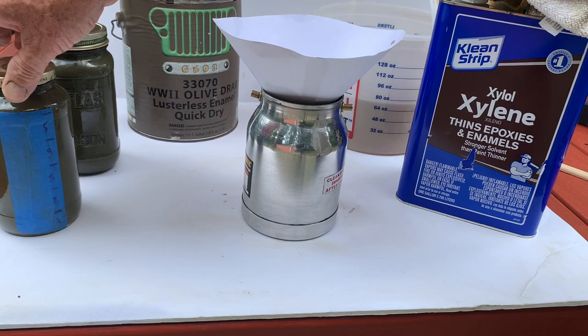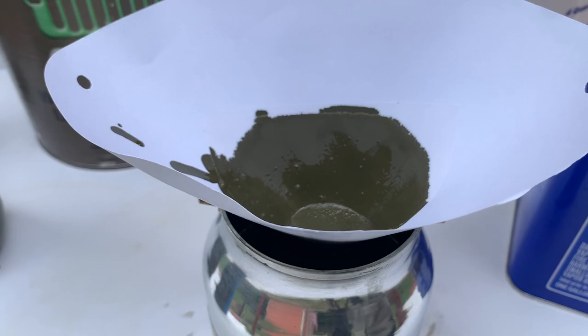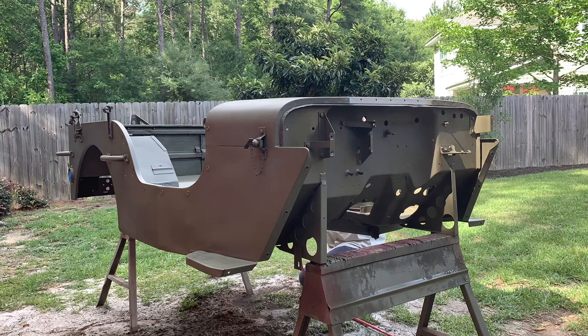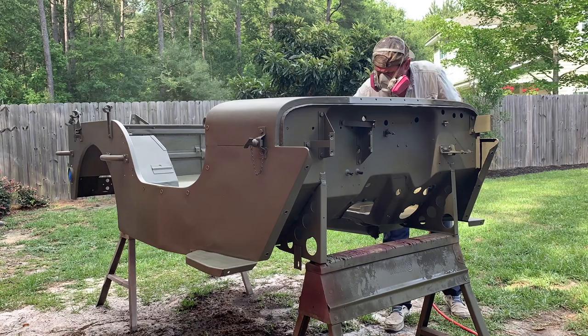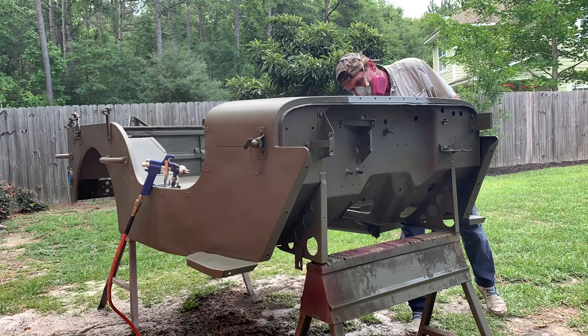You're going to strain there. There is a little bit of debris in the paint, so we took it all out — that should spray really nice through our gun. It's a nice cool day here in Charleston for the month of May, about 70 degrees, and the outside humidity is about 55-60%, so we don't really have a problem with moisture in the air. Every different paint gun has its own manufacturer specifications for pressure and spray pattern settings. I'm using a simple cup gun from Harbor Freight — I paid about $25 for it — and the pressure I'm running is about 60 psi at the gun. I took a piece of cardboard and adjusted the fan to about a 6-inch fan at 10 to 12 inches.